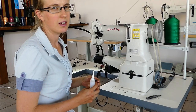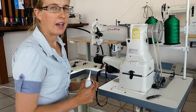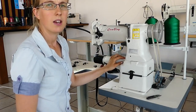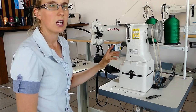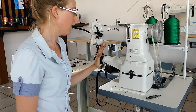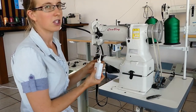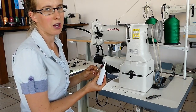It's important to oil your machine to keep all the moving parts lubricated. Generally, we advise after 8 hours of work you should oil it. There are several points on the machine that will need oil. They usually have a red paint mark around a hole in the casting. Generally, any hole in the casting you can put some oil in — it won't hurt anything at all. Just one or two drops of oil in each of the holes after approximately 8 hours of sewing. The machine will come oiled so you don't have to worry about it straight away.